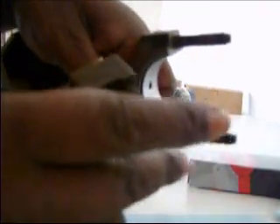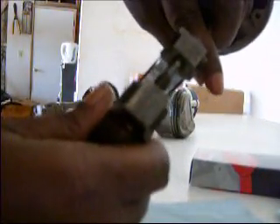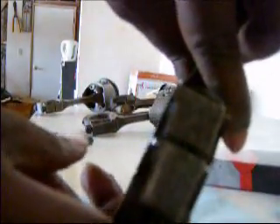One thing I forgot to mention — after you do this, pay attention: these are stamped with numbers. This piston is the number four piston, and number four is on this side, but there's also a number four on the connecting rod side as well. Make sure those match up. Put your nuts back on your connecting rod to keep them from getting lost — I almost lost one right at the beginning of this video. Put your nuts back on there and set it aside until you're ready to lube it up and install it. So, one down.